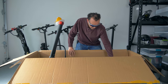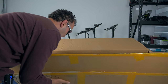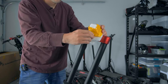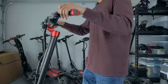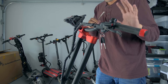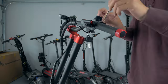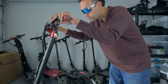I really don't know how I'm going to hold this thing up, it's so big. Alright, so the first thing you have to do is install the handlebars. Just unwrap this — looks like there's just four hex nuts, easy enough. All of the items on the handlebars — the brake levers, the bell, the throttle assembly — it's all loose, and that's intentional because things shift in shipping. So you have to tighten them all up and position them where you want. I usually like the throttle about level and the brakes just under that. We're going to install the damper now; there's a really great instruction sheet for that. After that, we'll inflate the tire, check the settings, and then we're good to ride.